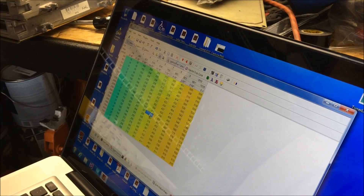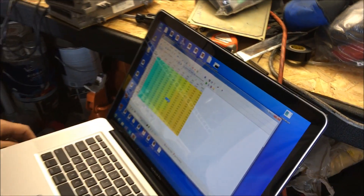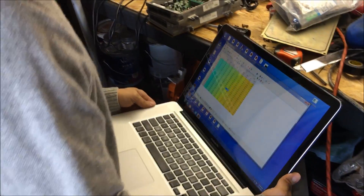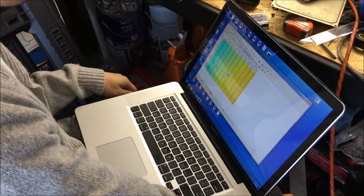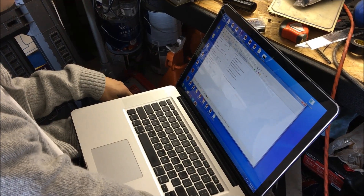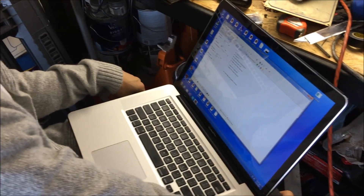For what he has — a mini-me — it is slightly different, but for a base map it's never gonna be perfect, that's why it's called a base map. The idea is just to make sure it'll get you up and running relatively safely. We could use regular parameter changes to up the RPM, fiddle with the idle, or the VTEC point, but ultimately you'd need a dyno tune to sort all of that out properly.